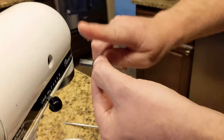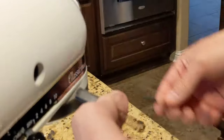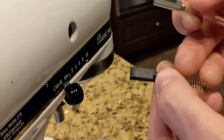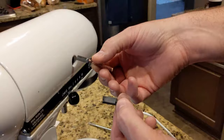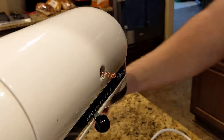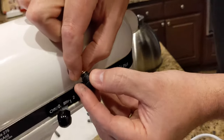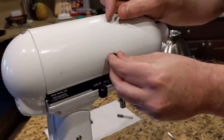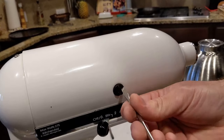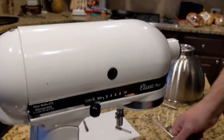You can see that the notch is up and to the left, about the 10 o'clock position, so I'll make sure the new one is also in the same 10 o'clock position. You can see that this one is worn and the copper has discolored — this is the new one. We're going to put it into the mixer in the same direction that we took it out. Take your cap, the spring goes in the center of the cap, you're going to push and turn. Be careful because it's under spring tension and it will go flying. Get the spring started, turn it to the right just until it's snug. Let's see how we did.